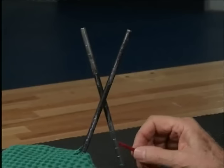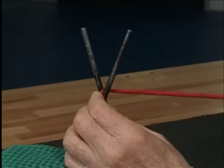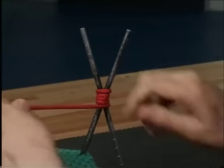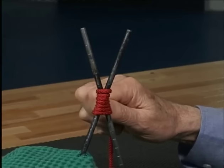We start with the tying wire from the inside to out. Bend about 3 to 4 millimeters. And first we make one wrapping. Then the second, the third, fourth, fifth, sixth, and the seventh wrapping. While doing this, we always keep the wire tight. To finish, we lead the wire from inside out and break it off on this edge.